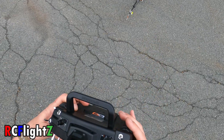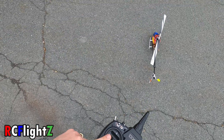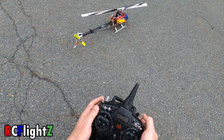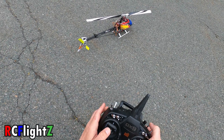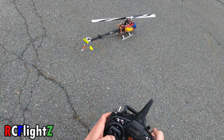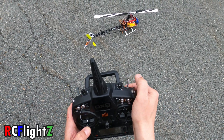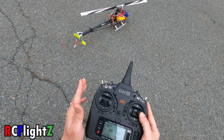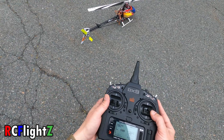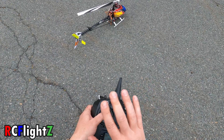I calibrated the ESC, so that was good — it seemed to work a little better after that. I'm going to kick the hold off. This stick is all the way down, so we're getting a lot of negative right now. When I kick this hold switch off, it's not going to spin because it's in normal mode, but those blades are going to kick to about 5% negative instead of 11.5. And we can see that when I flip this hold switch — those blades just switched. That's already telling me my programming is online.